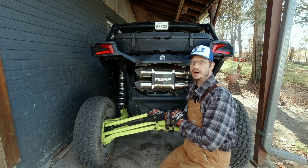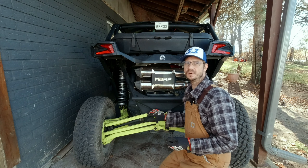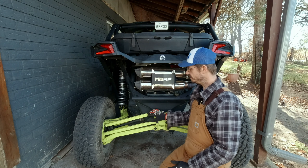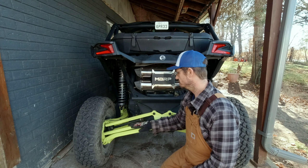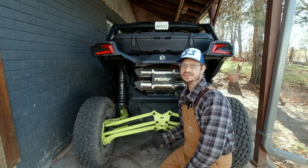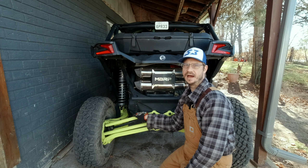Even if you have a fully stock suspension from the factory, I still recommend you do a ride height check as per the Can-Am manual. There are also some Fox race tunes you can find online for the Maverick X3 very easily. Typically from a dealer these cars will come sitting pretty low. One visual indicator: if nobody's touched the ride height from a dealership, the radius rods at the rear will be almost level, which means the car is sitting low and you're not using all the suspension you paid tens of thousands of dollars for.